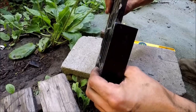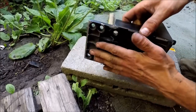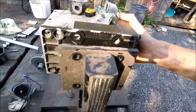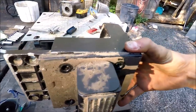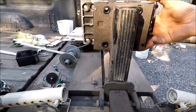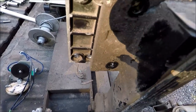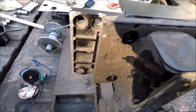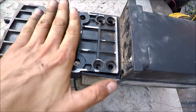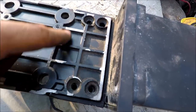In the future it'll just bend again, so what I should probably do is get a flat piece of steel and reinforce it so that it can't bend anymore. You can see what happened — these holes line up with these holes right here, so you have all this up against a steel plate except for this part, which is exposed. That's exactly where it bent. This part goes onto the winch motor and this part just rests up against the plate, so all the weight of the motor is going right through this aluminum bridge.